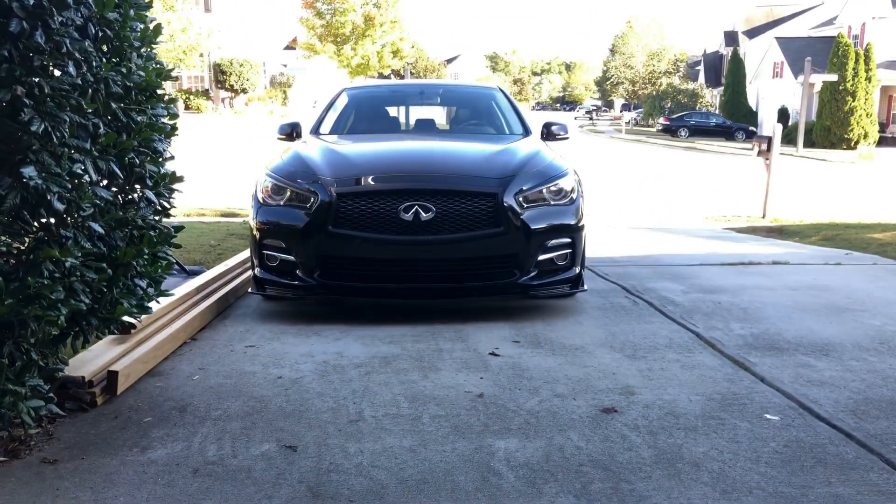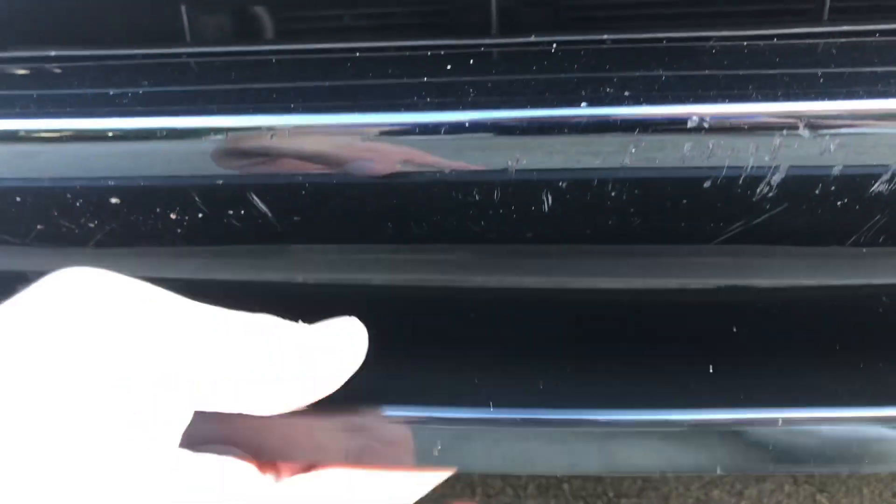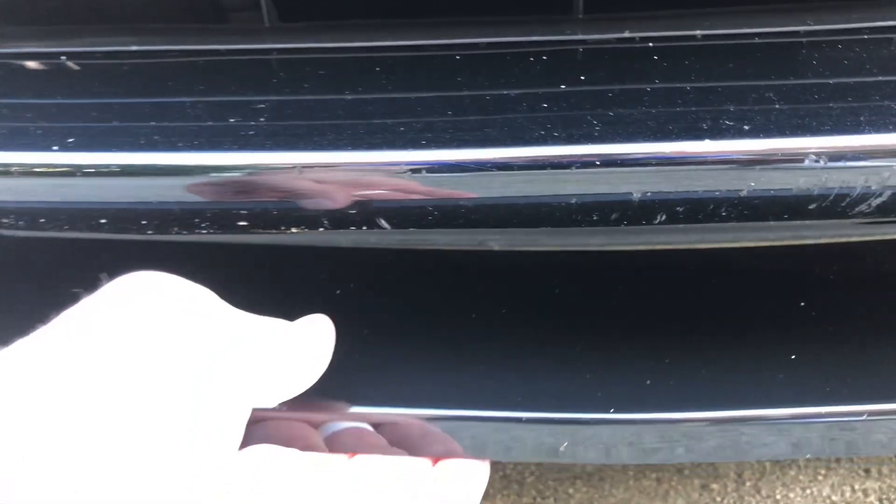Here's what I don't necessarily like about the splitter. You can see it kind of sagging here in the middle after just a couple of weeks. It's because there's not enough support — there are two mounting points but there's nothing in the middle, so at high speeds it's caused this to sag and get a little flimsy. I'm not super concerned though; I think I can get a little spacer in there and figure something out. The problem is how much longer can I go before it starts to put strain on those two little screws on the underside. We don't want it to start to loosen up, come apart, or really start to sag. You can see the screw and the mounting point over here — it's just not enough support.